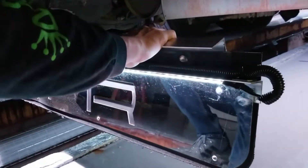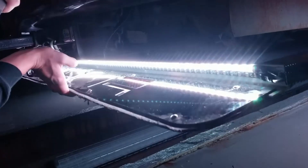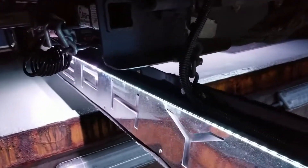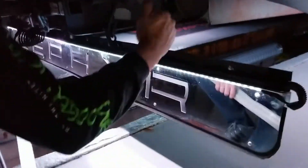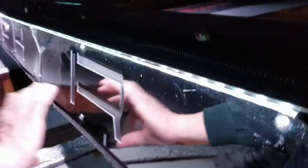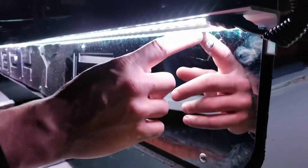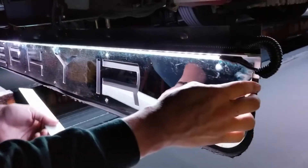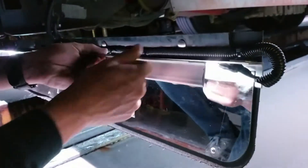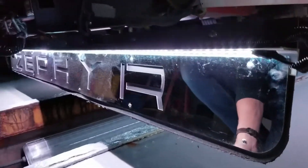When you do that top mount, you often run into the problem of the rock guard not being able to go completely horizontal, and if that's the case you will end up bending your rock guard. So we actually recommend putting it down a step. These rock guards have a rubber backing and a chrome finish on the front. You can attach the rock guard about two or three inches down from the top using the existing screws — pull those screws out, peel the chrome back a little bit, slide the rock guard down right behind it, drill those holes where they line up, put your screws back through, and tighten them on. Then you do the wiring itself.